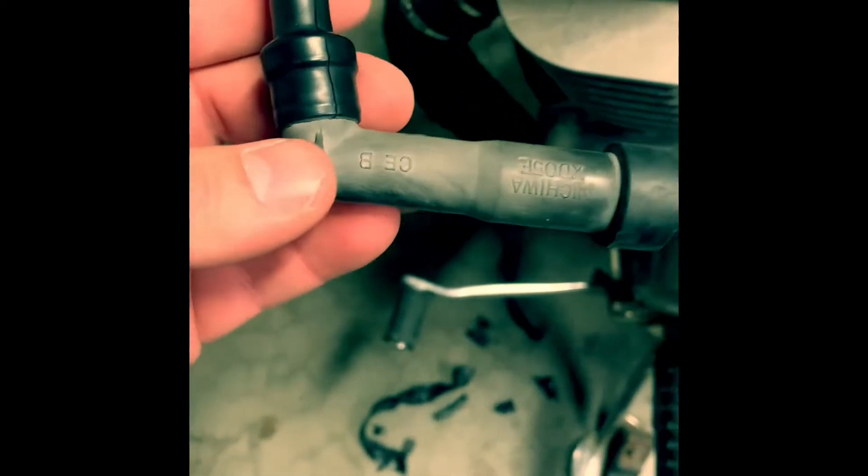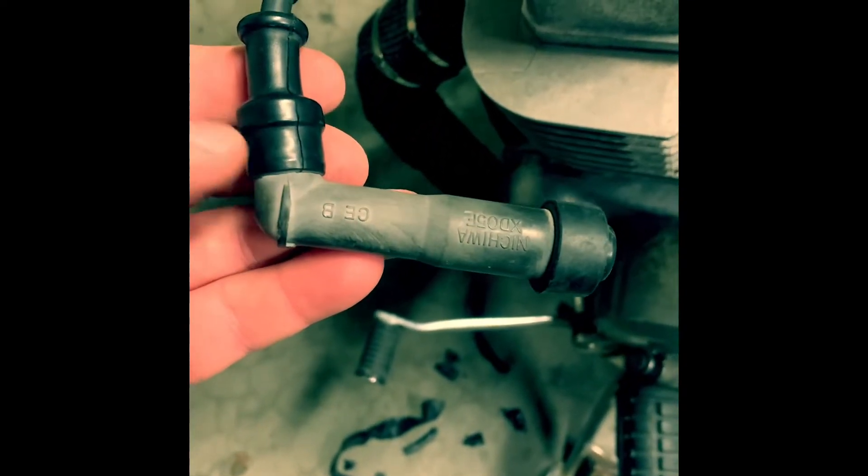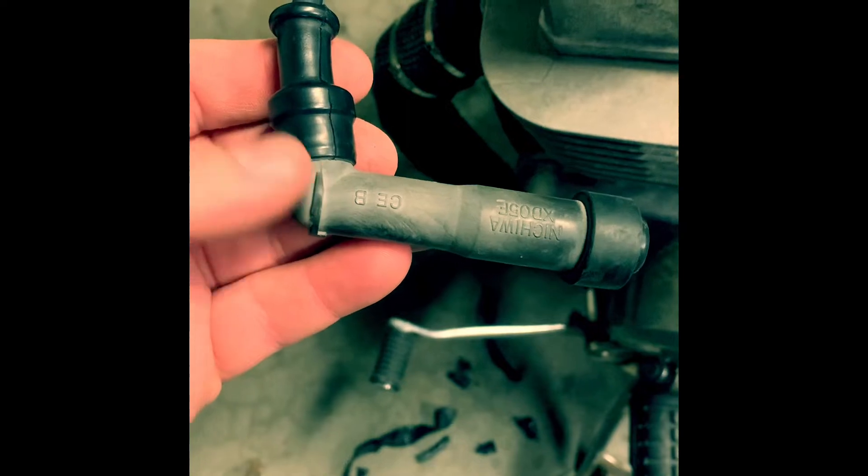You can see right there there wasn't any spark. We'll keep going up the road and see what we find. I went ahead and pulled the spark plug out and just lightly screwed it back into the engine. This boot actually screws off so you can check the connection inside there.